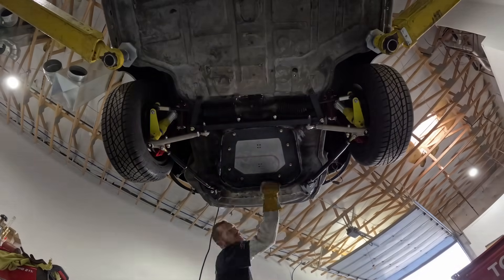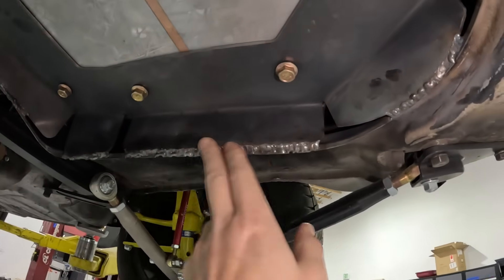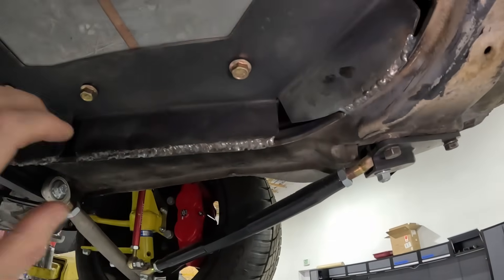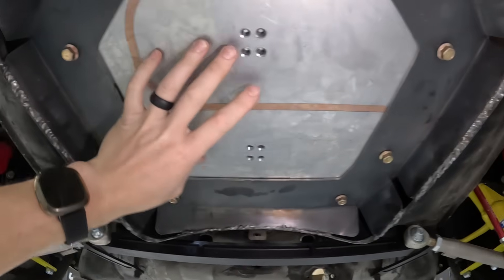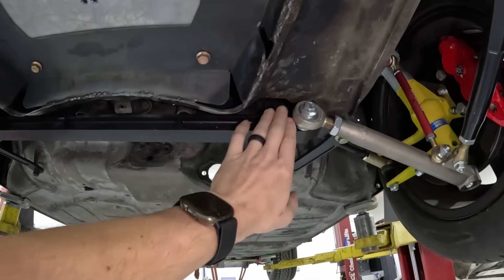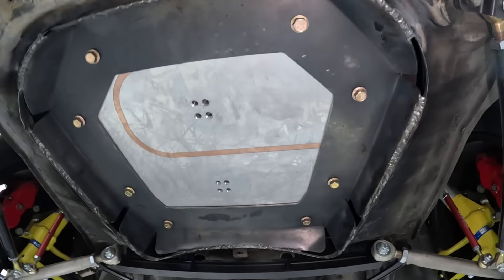The welds are all done. Everything I can get to — basically stitch welding — this whole side is welded, this whole side's welded, this whole side's welded. So it's super strong. This is thicker than this and it really ties the bottom body of the car together, especially through the battery box. It's almost like a cross member. So the front of this is now extremely strong, especially with the new improved suspension cross member and stuff like that. This is going to be crazy strong.